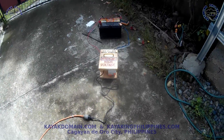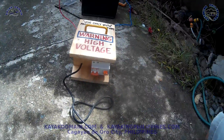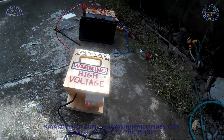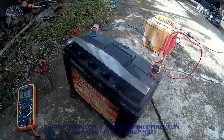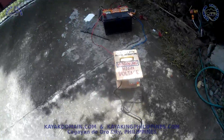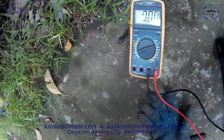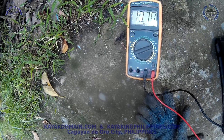Now testing the charger with a real battery load. We'll set it to 60 minutes. I have 10.2 volts — distilled water has already been added to each cell. Now it's gone from 10.2 up to 10.68, 10.7 volts, so it's really a fast charge.